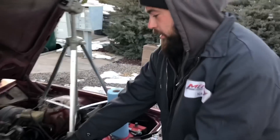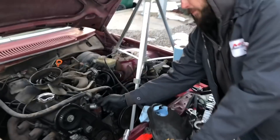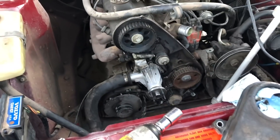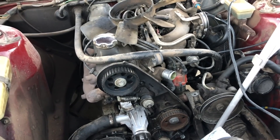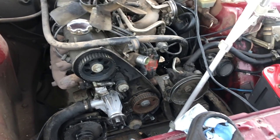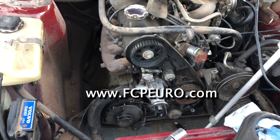When you're setting the timing, you can always look at the distributor to check which one is cylinder one. Number one is always on the thermostat bolt — so if we took the cap off, it would be aiming at it. You know what, I may as well do a thermostat while I'm in here. I'll buy a new one with warranty through FCP.